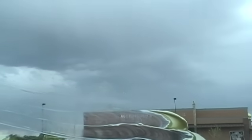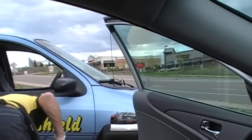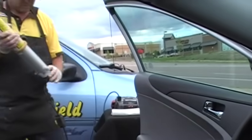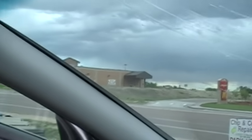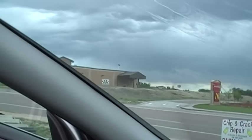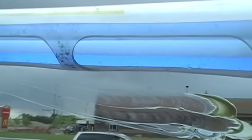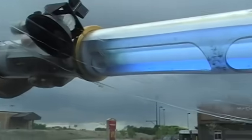We've got enough overcast today that we're going to be using our big cure lamp, which we've got right over there. The nice thing about that cure lamp is — you see that gold ring on it? It actually has a suction cup built onto it, so you can suck it down onto the glass once you've gotten it positioned over the crack, and you don't have to hold it.